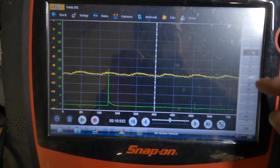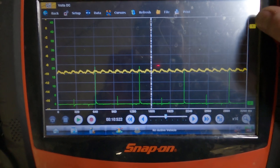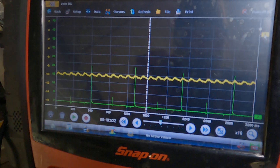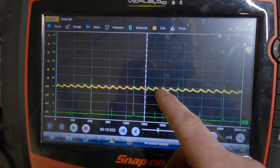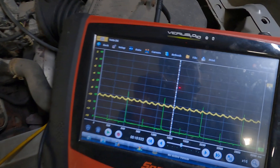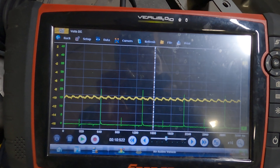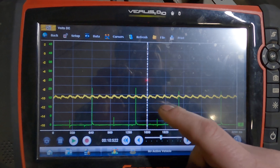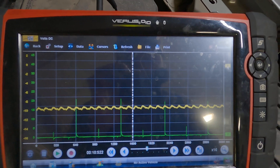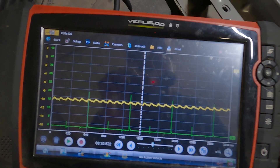It's harder to see when zoomed too far in, so I back it out. Even seeing a few different revolutions is fine. Move the cursor up or down until it's lined up with a grid line, then look for the humps. I've got one, two, three, four, five, six — six even humps on a six-cylinder engine. That tells me I'm making compression on each cylinder. When peaks rise steeply, chances are you're making good compression, though you could still have a valve train issue where it builds compression but doesn't breathe properly. So again, this is just a directional test.